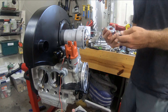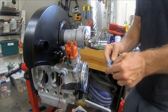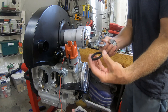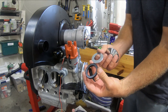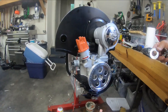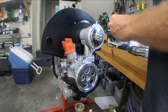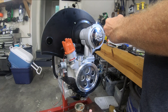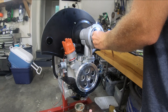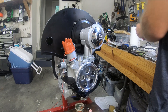Interestingly, the normal pulley shims look like this and there are nine of them. You would normally put a certain amount on the inside and a certain amount on the outside. The pulley shims for this one — if you compare them — have a much bigger hole so they can make it around this square section here. I'm going to take about three or four of these and put them on the inside.